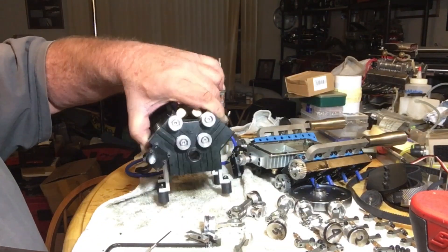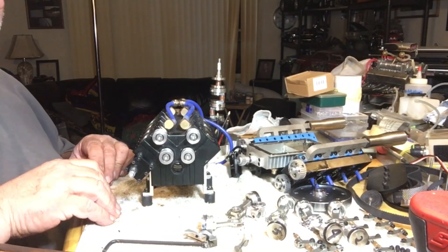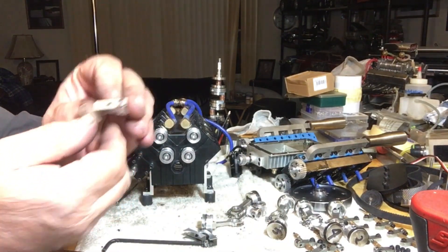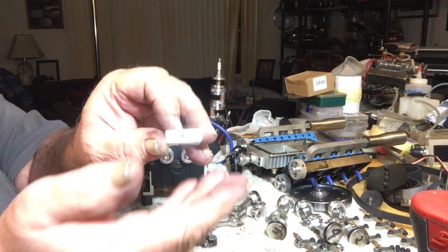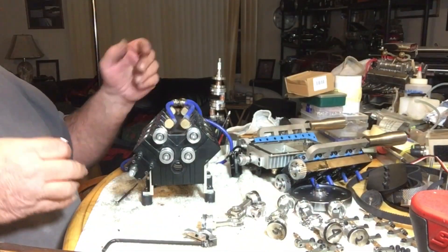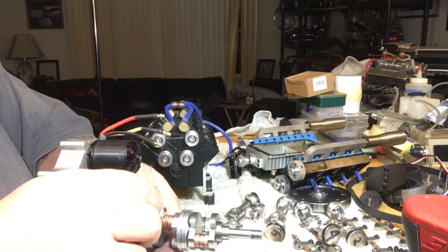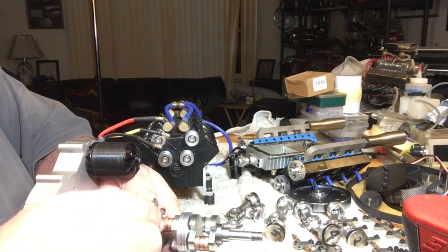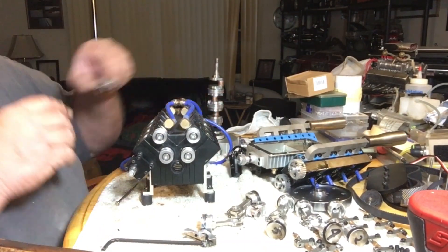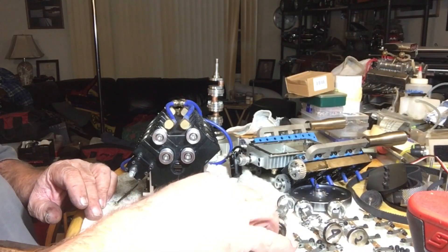It gets pretty sloppy when I tore it apart, but I wasn't scared. Now you do have these little collar caps here — everything is numbered. What this does is after your crankshaft goes in, it sits on the very bottom of the crankshaft and holds your bearings in place so they don't move. It's a very nice fit on everything — I was very impressed with the quality of the machine work inside this engine.